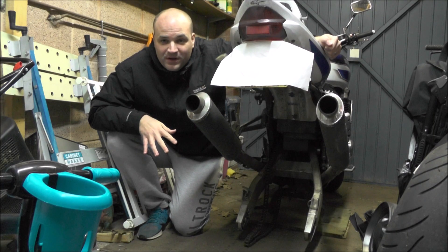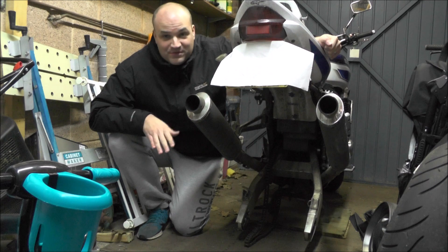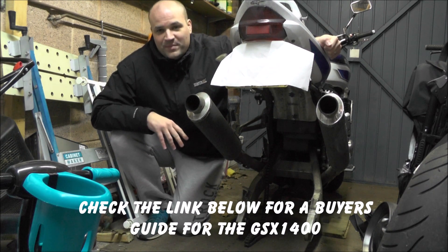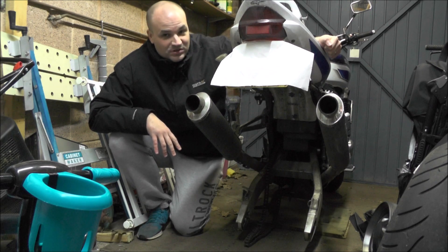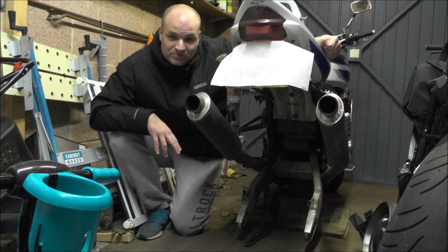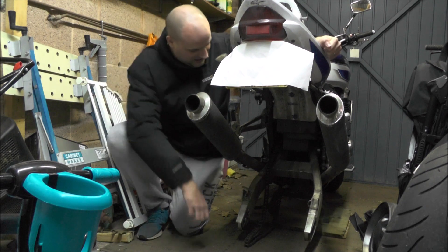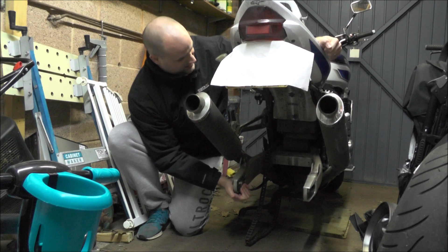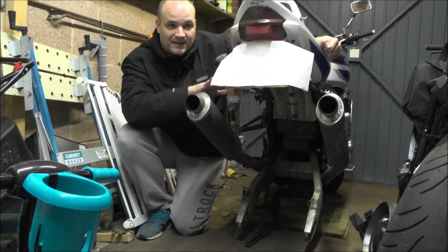Here I am crouched down with my GSX 1400. Just before I was due for an MOT I thought I'd better check it over, as I do every year. The bike is used throughout the year — it's an all-weather bike, not put away and treated with kid gloves. It is abused. I do maintain it but it gets a lot of use in rubbish weather. I noticed when doing the MOT check that the rear swinging arm is a bit rocky from left to right, so it looks like the bearings. I've stripped the entire back end down and taken everything off.